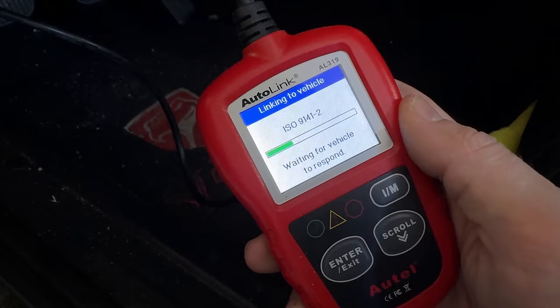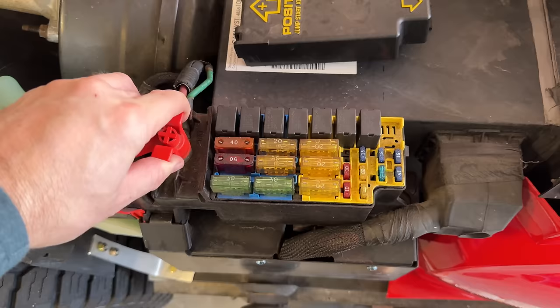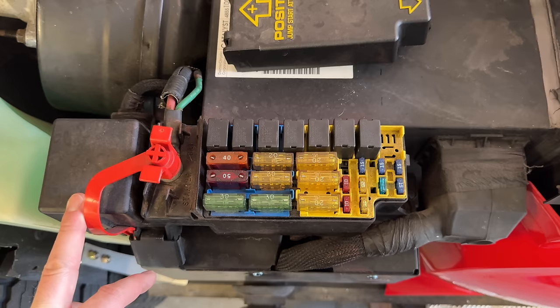Uh-oh. I did some Googling, and this clicking relay seemed like a problem that was common enough that it might be something easier. It's commonly caused by a bad battery or a poor electrical connection, but since the starter was cranking good, we ruled that out.